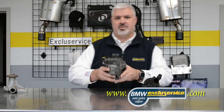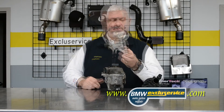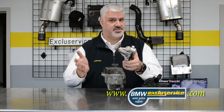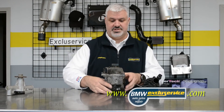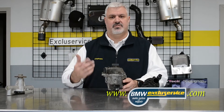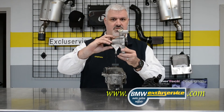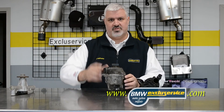In your modern BMW, you now have electric water pumps. These are the old school ones which are mechanical. These were a lot simpler, and these things did use to fail — they failed at about the same rate as the modern ones. The benefit of the modern ones is they can run at variable speeds. For example, if you're sitting in stop-and-go traffic and idling, the mechanical one is only going to turn as fast as the engine's turning. The electric ones can send more voltage to it, which is going to make it spin faster, making the car more efficient and preventing it from overheating when sitting in traffic.